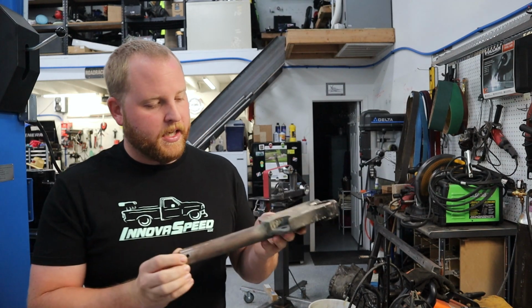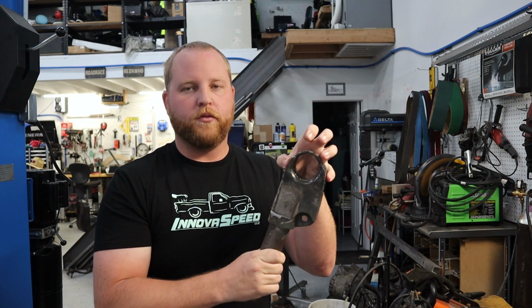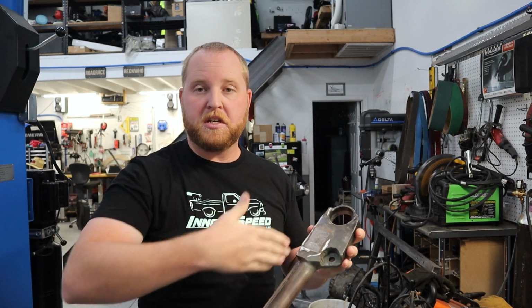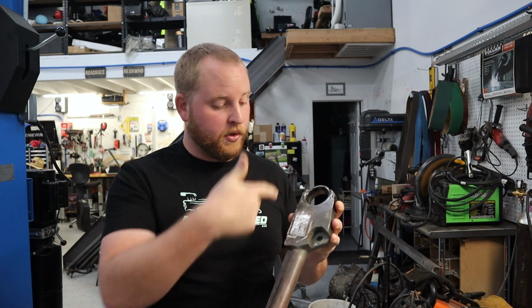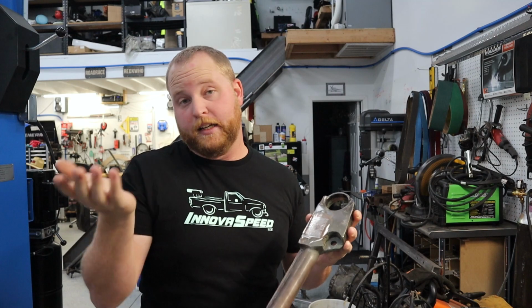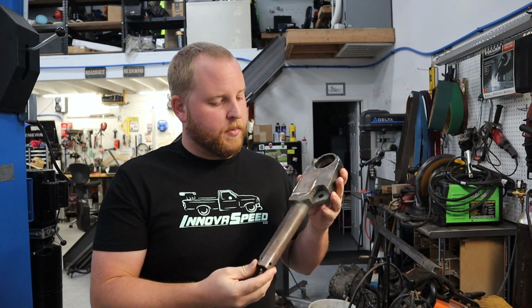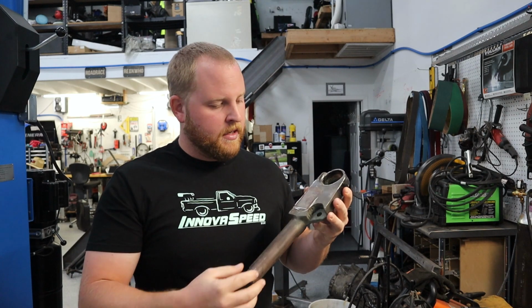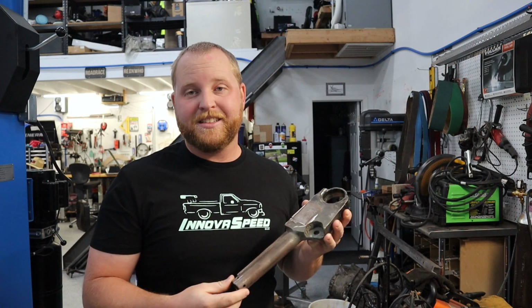To explain very simply, this is where that other piece connected to, and this is all the boxing I did to really try and reinforce around this ball joint and where the suspension loads were. All that's great. In fact, from a positioning standpoint, the ball joint, shock mount, things like that actually never changed. It worked really well. But I did move away from this because the strut rod style suspensions kind of overcomplicate with a bunch of extra components. They can introduce weaknesses to the suspension.